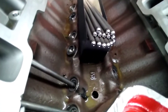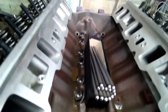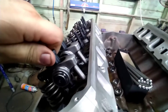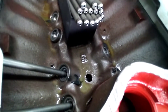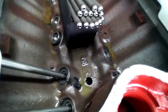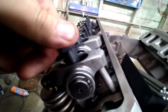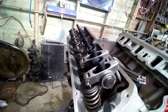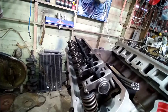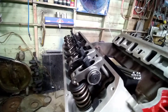The way you adjust these is with your lifter all the way down in the bore — where the cam lobe is not trying to push up the lifter. What I like to do is tighten this until the pushrod just starts to plunge into that lifter. Tighten it until you can feel the spring of that lifter kicking back on you — you'll see that pushrod go into the lifter a little bit. Once I get that, all I do is go ahead and turn it a half turn. Some guys do three-quarters. The thing about valve adjustment is you can have a group of ten guys and not a single one of them will do it the same. This is just the way we do it — I'm trying to explain it so anybody can understand it.